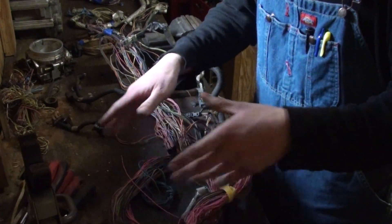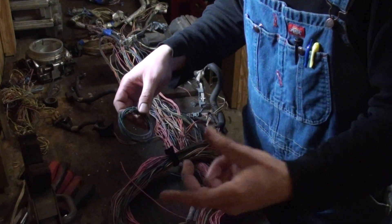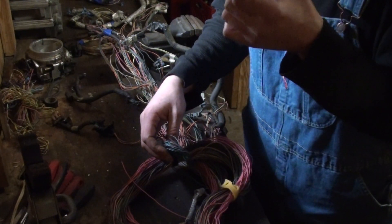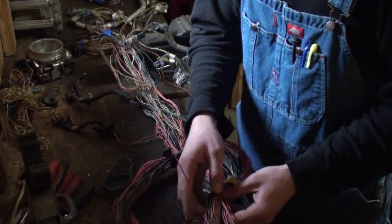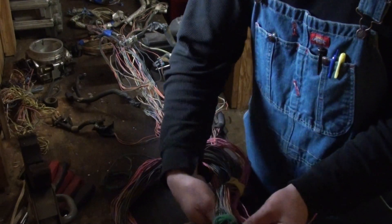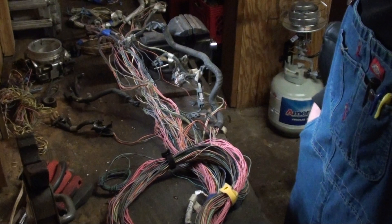I've got a couple of loose wires I saved: one is for your check engine light, the other one is for your OBD2 diagnostic port. Some of these are for your vehicle speed sensor - I highly recommend you run a vehicle speed sensor even if you have an older vehicle that never came with one. Dakota Digital sells a nice little adapter for forty or fifty bucks that works inline with your automatic or manual transmission speedometer output.